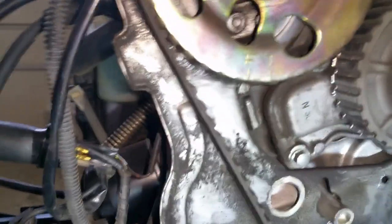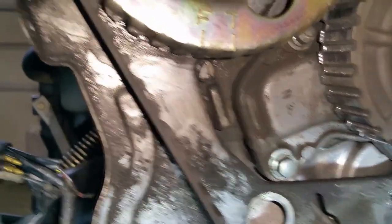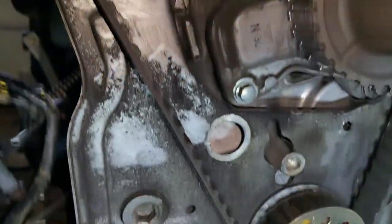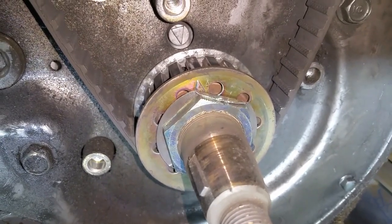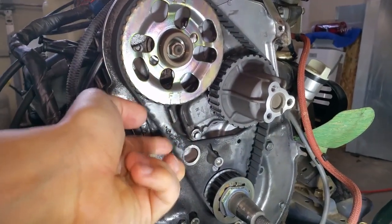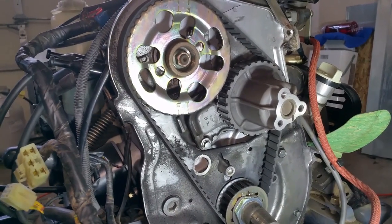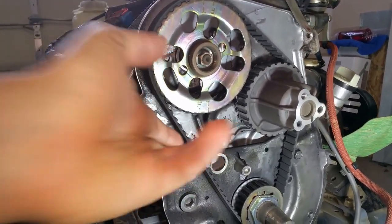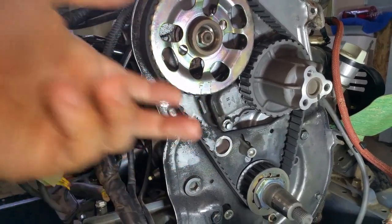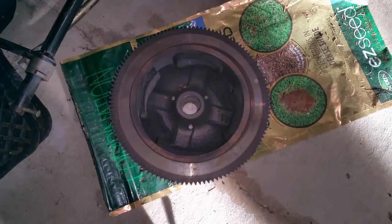The charging coil wires are routed through a little pin that holds it here in this hole and then a rubber grommet sends it over to the boot. For the timing marks — there's a little arrow that has to match up with the T on the camshaft pulley, and on the bottom there's another timing mark on the timing belt pulley off the crankshaft — those two marks need to line up. Look how loose this belt is; I'm surprised it did not slip a tooth. It actually stayed in time, which is very surprising and goes to show the engineering behind it.